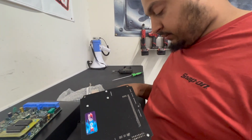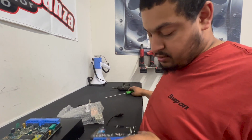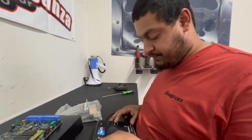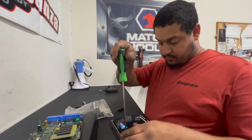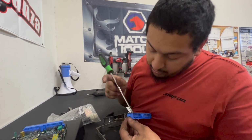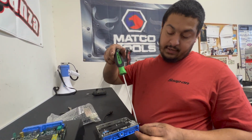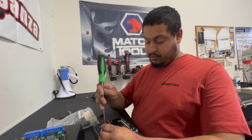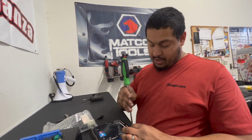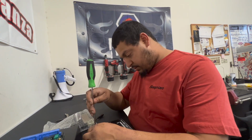No, he didn't need that. That was the amplifier. And you fixed that? Yes. So you fixed most things. Is there anything that you couldn't fix? Well, we haven't fixed the blower motor being on 100% of the time yet. I don't know if he wants to go through with tracing that out. Just unplug the resistor and it shuts off. Not ideal, but he's already in this a lot of money.